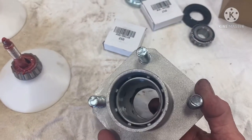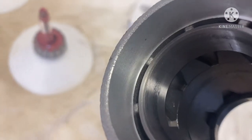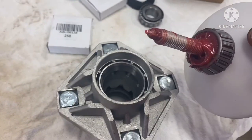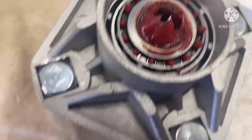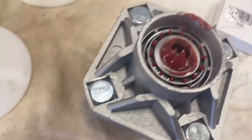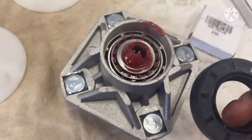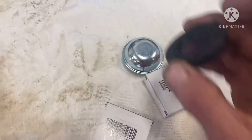We always want to start with the back of the hub. You've got the front and the back of the hub — that race is also coned, you can see it in there. So what you want to do is put the bearing in cone-side in, just like that. This is what it'll look like when installed; it just flops around in there, which is okay. Then you've got the seal — you've got to put a seal on the back to keep dirt and debris out. The cap on the front is what keeps the dirt out of the front.